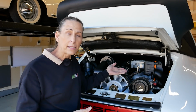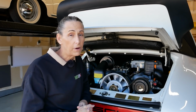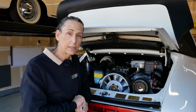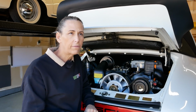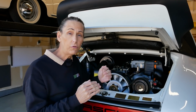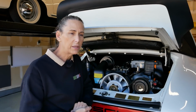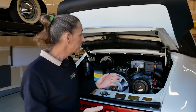It's not going to be a gasket, because we'd see fuel leaking all over the place, and the cylinder would be firing, but that's not what's happening. We're not getting any firing on that cylinder at all. Now, I suppose it could be a compression issue if, say, some of the carbon broke loose and was holding one of the valves open a little bit, but it can't open too far or the piston will contact it. I think we would also hear that. If it was on the exhaust, you'd hear a chopping noise in the exhaust, and I don't think we really hear that. Same thing for the intake.